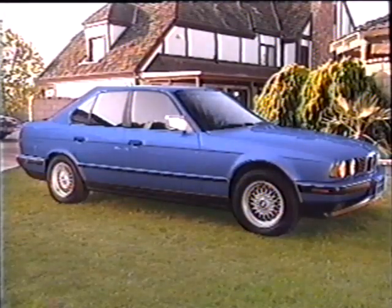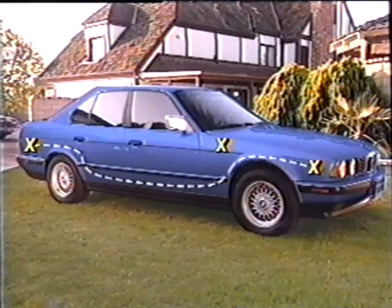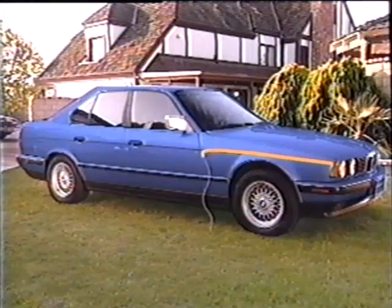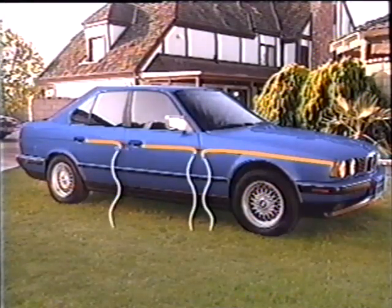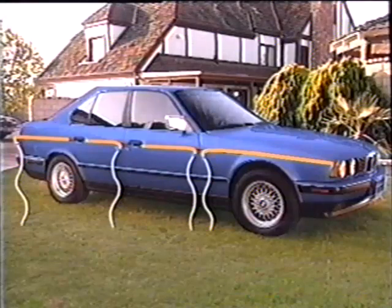First, plan where to install the Californeon strips. Then, using a portion of your 30-foot hookup wire, route the main power lead from the hood area to the furthest connection. Then find a suitable location for the power pack. After that, cut and measure each Californeon strip, leaving 1.5 inches on each end. One end for finishing and the other end for terminating. Now use another connector to attach 3 feet of hookup wire. With that, it is now ready to test and apply. Now repeat for each section.